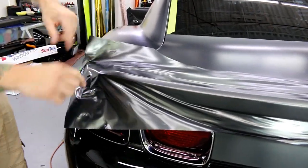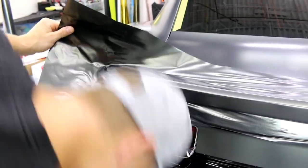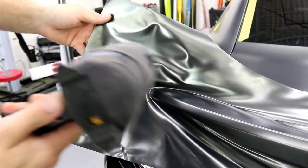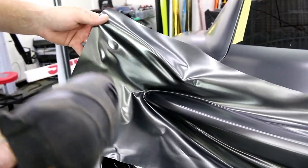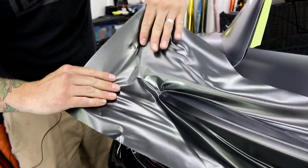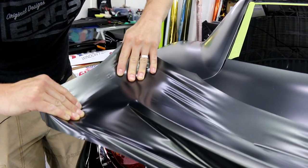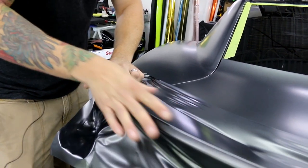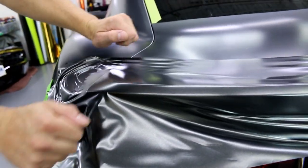It's going to get a little trickier over here. I'm going to bring the vinyl back a little bit and heat it up again. There should be no movement here because I didn't stretch this area — so the vinyl is not pulling back, which is very important because we're not adding stretch on top of stretch. I'll place it and spread everything out around the end so that when I go to tuck the vinyl around and heat it, it's all going to shrink in and underneath.